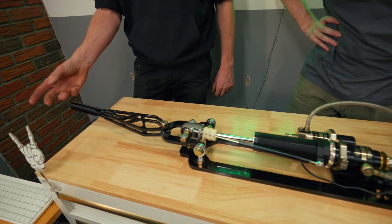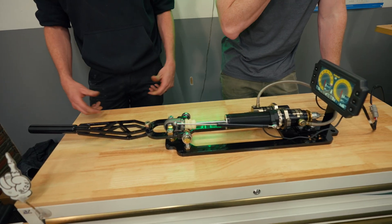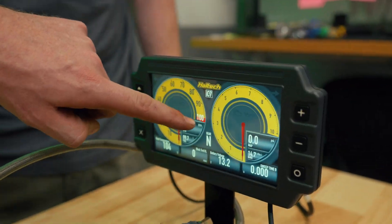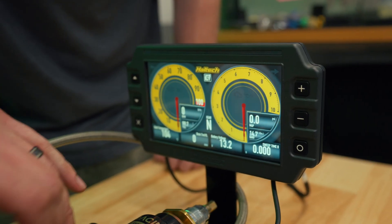So we had the entire shop doing this. Even when all the guys came up for ice racing last year, we were timing everybody with phones — but obviously that's not super accurate, and maybe somebody doesn't go all the way and they're cheating a bit. So we put some data on this. Now I can tell exactly when you get to full compression and full rebound. We added the screen with the Haltech IC7 — you've got your distance here, it goes all the way to 100 millimeters and back, and this is your time.